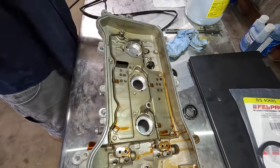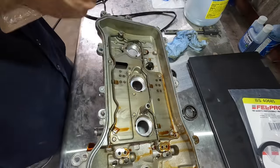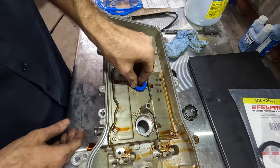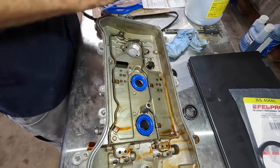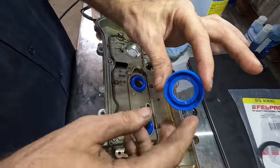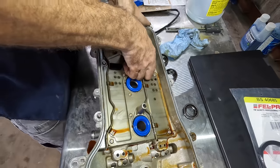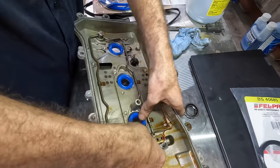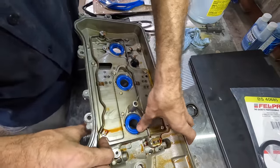Good. Now, we'll unbox the new ones, get those things set up in the holes, perimeter gasket this thing, apply a little bit of RTV sealant, and get it all back together. There's one. Number two. It's important that these are faced the proper way. If they're upside down or inverted, you won't be able to get that to spread past the spark plug tube seals. And that can be frustrating. These are looser than I thought. They just kind of press down in there. That's not what I expected. Okay, that works though. I guess these fit somewhat loose.